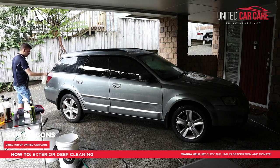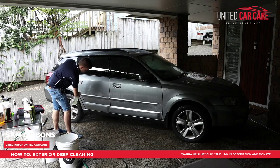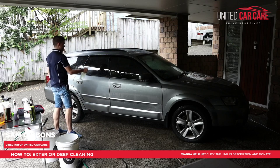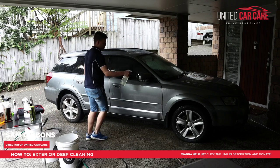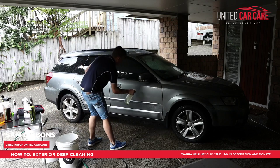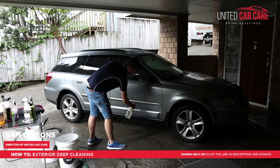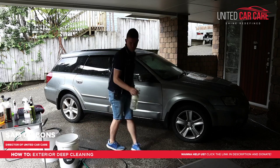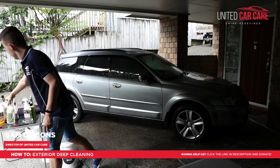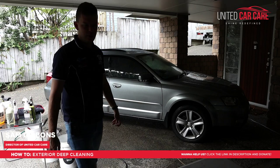Glass, plastics, and some of you think, oh, it's a wheel cleaner, you can't spray that over the car. Iron Burn and Dragon's Breath aren't technically wheel cleaners, they're really iron removers or iron fallout removers. Brake dust is iron, so they just happen to work well for that as well. Done. So then we just wait. That can take a good few minutes to react, so we'll leave that to react.